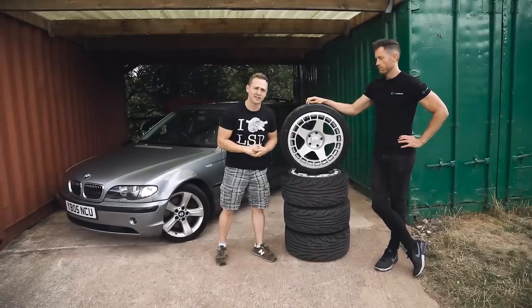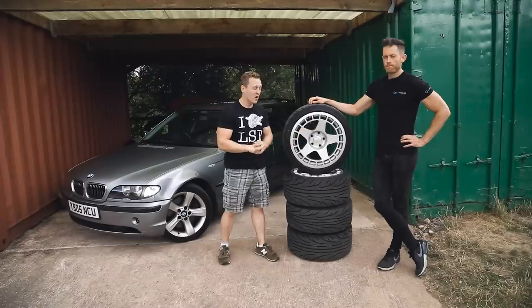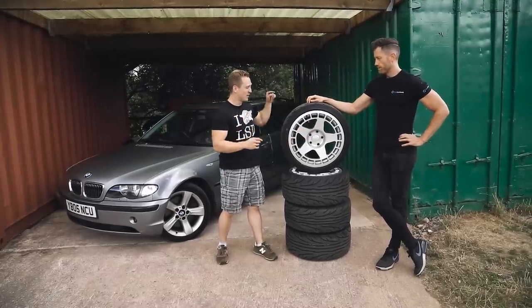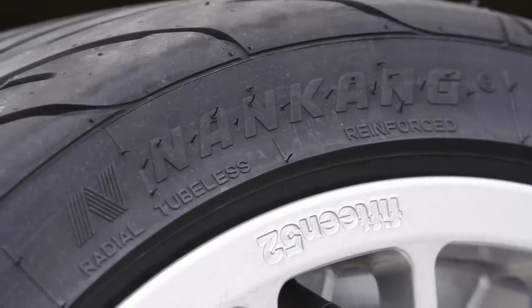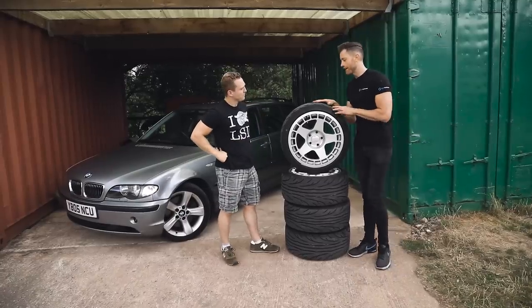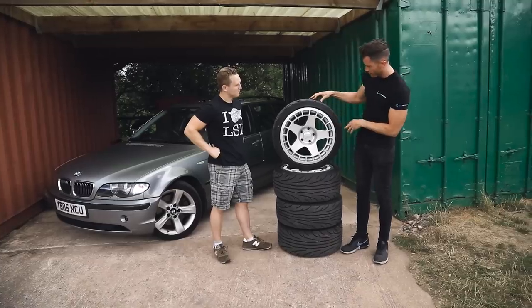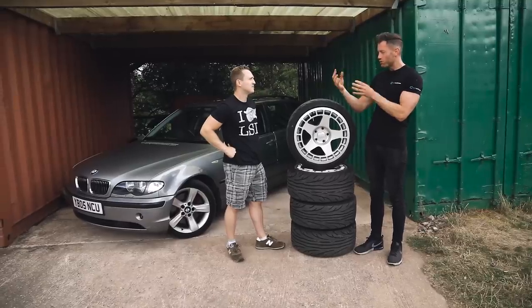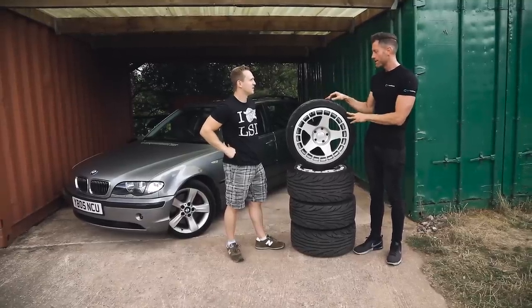The reason why John is here is because I asked his advice on which wheels and tires to get. Starting with tires — Nankang NS2Rs, why are they good? They are a good value track day tire, but not a full track day tire. Nankang have the AR1, which is a super sticky treadwear 80. These are treadwear 180 compared to those which would be about 300, which gives you a general guide of how soft and sticky the rubber is. So these are a good road tire that you can use on track and they'll shave some time off.